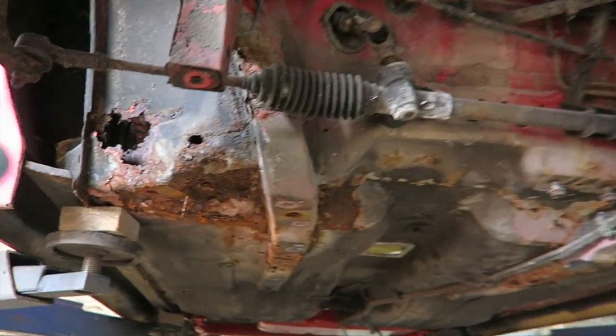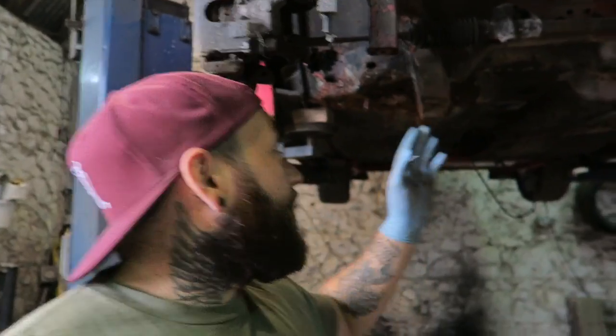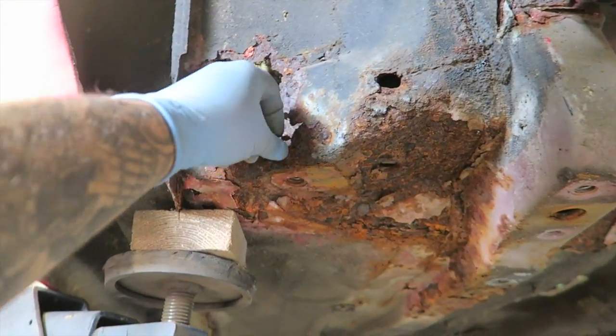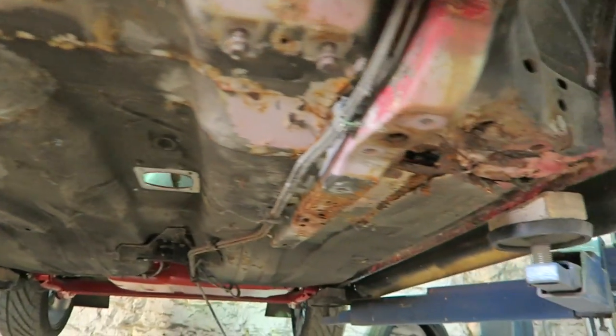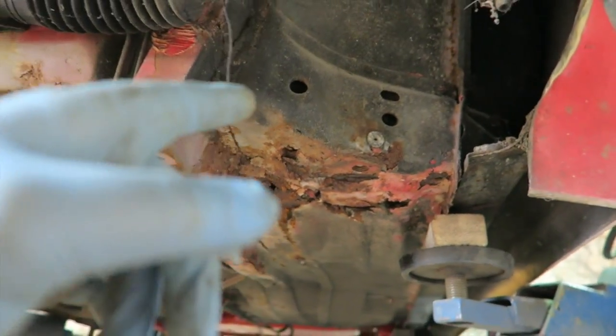So taking a look around at what I've just done, I've dropped the bottom arms off, mainly so we can get to these parts as well. You guys may remember, start of this year I think, I put a screwdriver through the car from the inside, just literally trying to find as much rust as we could back then to see what we had to deal with now, so we could end the rust repair at a certain point in the car. So when we got to this part, we could just hit it all in one go, because this again is gonna be sandblasted at the front here. Look how bad all that is. It's literally rotten here. And I think as we come round, yeah, just there as well, right through the bottom of the car. So yeah, you guys get the gist as to what is going on there.